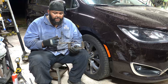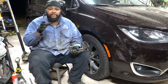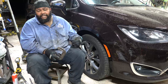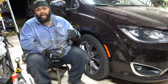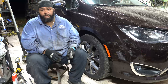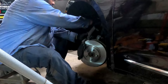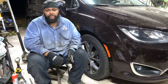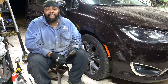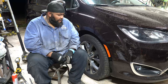Once you press the pistons back into the caliper, you'll be able to fit the caliper over top of the new brake pad. Once you get the new brake pads in, go ahead and put the caliper back together using those 13mm bolts. When you tighten those 13mm bolts, keep in mind you are most likely going to be the next person to take them off again, so do not over-tighten them — or you will be kicking yourself next time. Once that's completed, you're done.